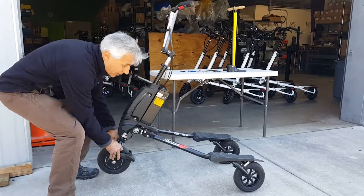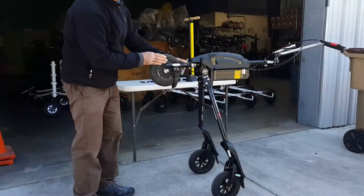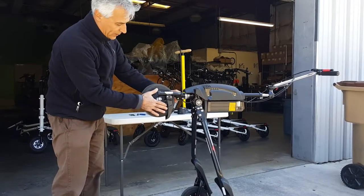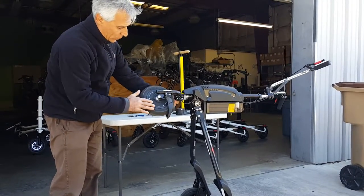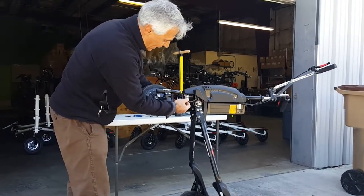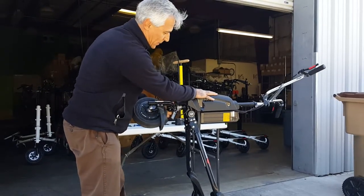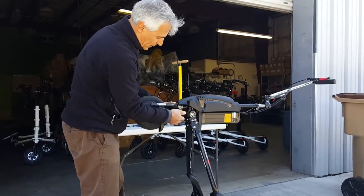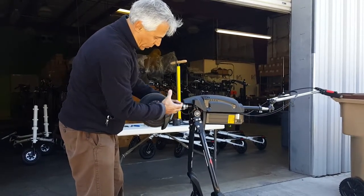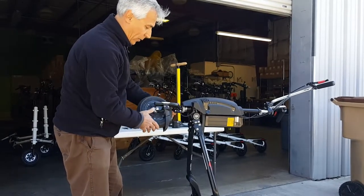This is a Trek Freedom and we want to show how to replace the tire or the tube, just by removing the front wheel. This front wheel is a hub motor so it has an electric cable that goes through the fork and goes inside of this mask, so we'll have to remove the mask, cut those zip ties, remove the wheel and pull everything and take it to the bench to do the tire repair.